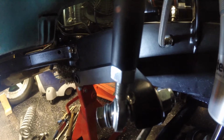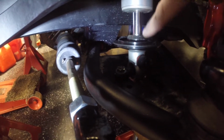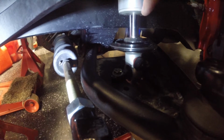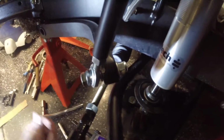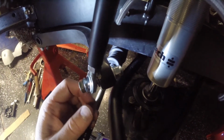So we've got another 2 inches in suspension travel, basically. You can see there's a couple inches of travel left in the suspension. The shock is pretty close to sweet spot, so it's pretty close to sitting in the center. So as you start rolling around and the body starts rolling, you can imagine there's some forces put on there.